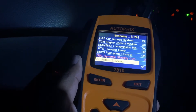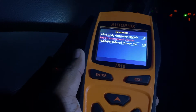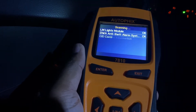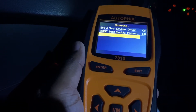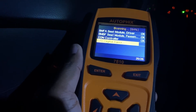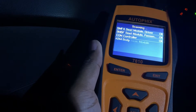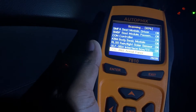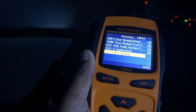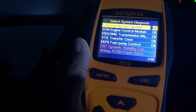There you go. DSC — dynamic stability control — you've got an issue there too. The instrument cluster, airbag — as you can see the airbag light was on. It's going through all the modules: the driver seat module, the con controller, the night vision camera, the con controller again. It's almost at 86 percent — almost there. We have the door driver module, the audio system. Here it is — the issues found are DSC dynamic stability control malfunction and airbag malfunction.